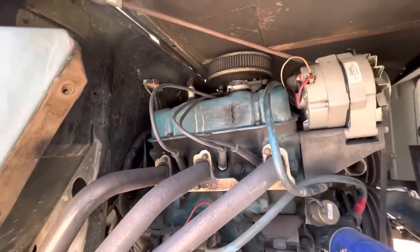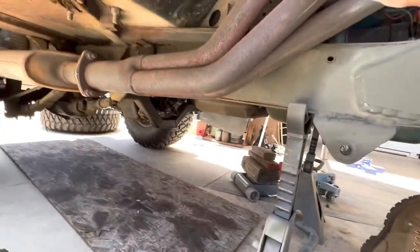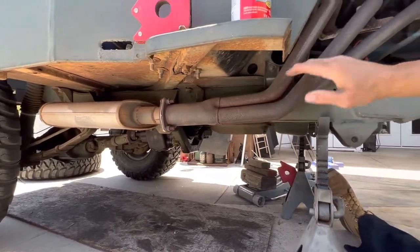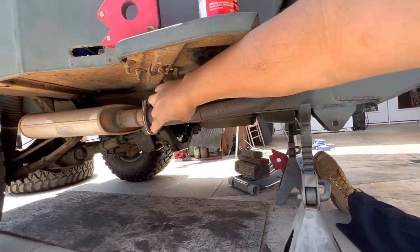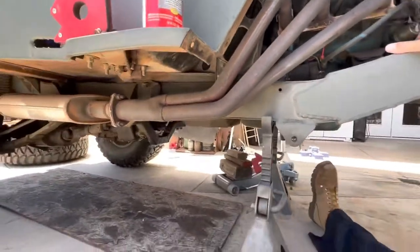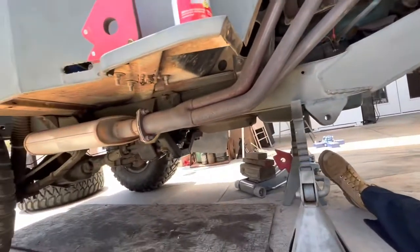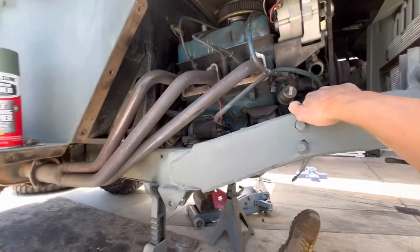That's the kind of filter I've got, sitting right on a two-barrel Rochester — pretty much stock everything. Back to the muffler: the plan is to cut it here, shorten this, cut it at the collector piece, and shorten it so I can fit it up there. If it doesn't work I'll just put it all back together. This is all just experimentation — having fun in the backyard.